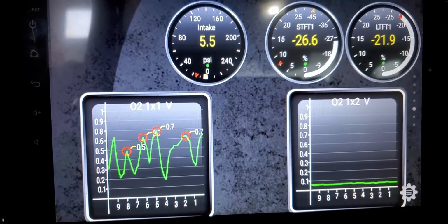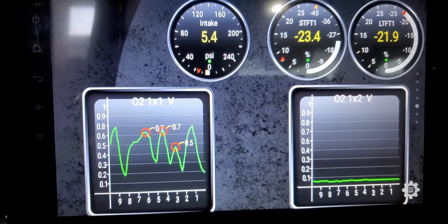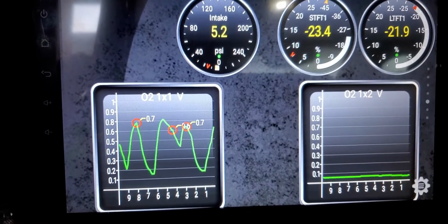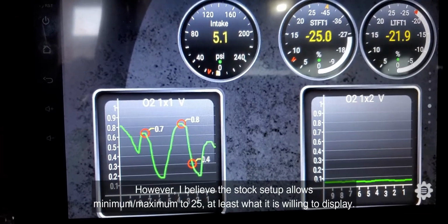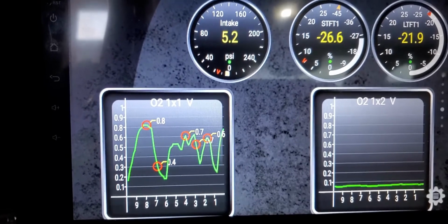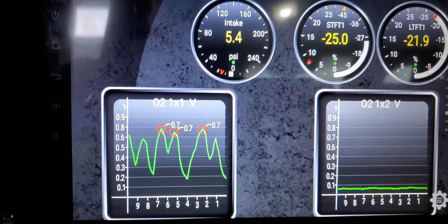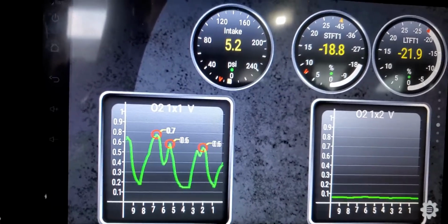This is with the map sensor edit. Notice the short-term fuel trims were getting as high as 30, which I didn't think was the case, and long-term is stuck at 21. That may be the max it can pull. Intake seemed okay at first, to where it wasn't reading as high on just normal acceleration, but it still shows 14.7, 14.8 with key on, engine off.